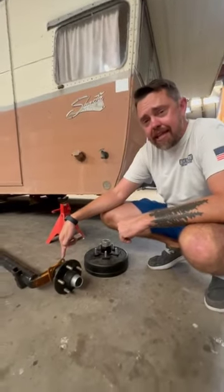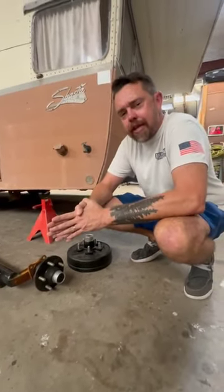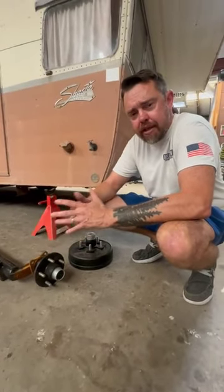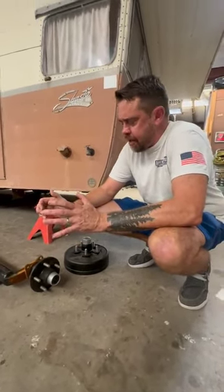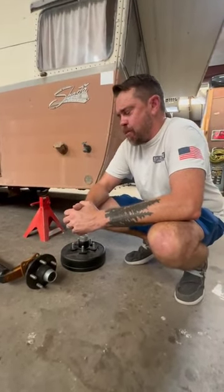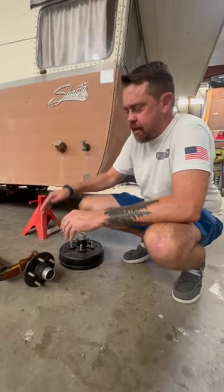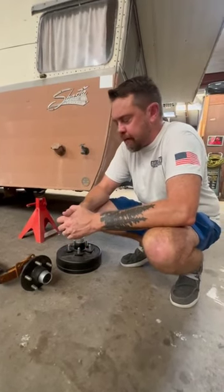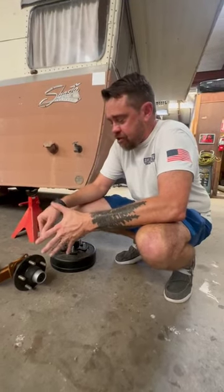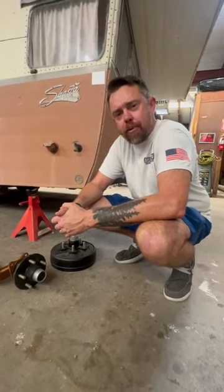it drives it into the rear, pushes it back out the front, so you can literally flush the grease out. Make sure that the new high temp grease that you're putting in there is bright red, it's all clean, you can wipe that off and then go about your business. And what that does, that saves you from having to pull the whole system apart and hand pack all that stuff like we did back in the day. So that saves a lot of time, and like I say, having these newer systems on here allows you to do it a lot quicker than what we used to.